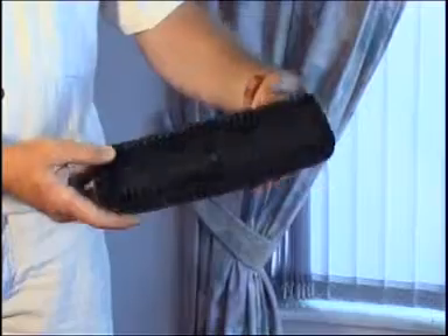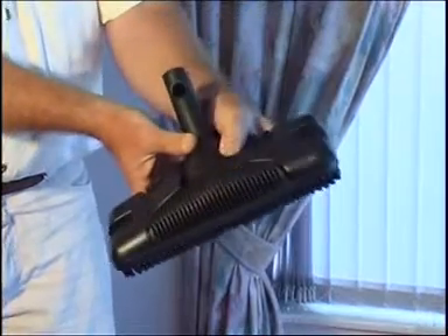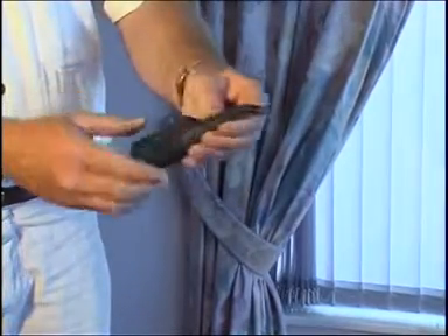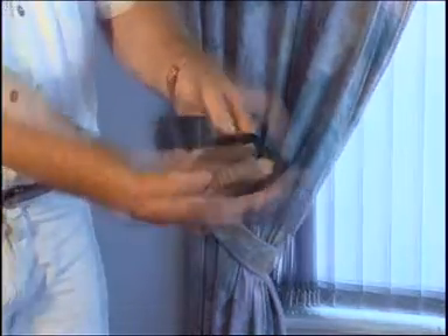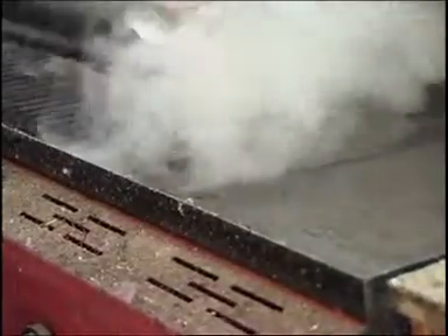Before we progress, it is important to understand the difference between the various accessories. The large heads for general cleaning and windows are your maintenance accessories for regular cleaning of light soiling — they are not powerful enough due to the wide dispersion of steam for stain removal. Stain removal is achieved by concentrated steam pressure; the most intense pressure is achieved with the single aperture nozzle. You then move to the medium triangular head for medium soiling, then your large heads for maintenance cleaning. Once you grasp this principle, you will be able to adapt your cleaning to virtually any situation.